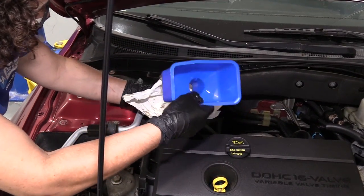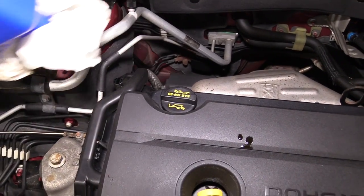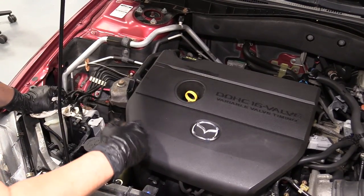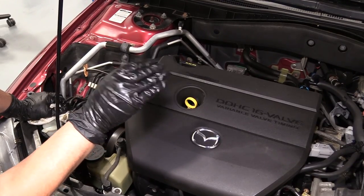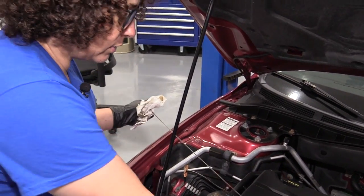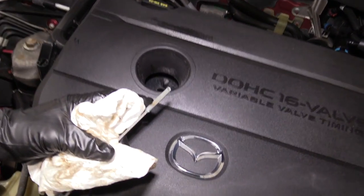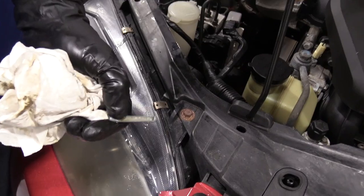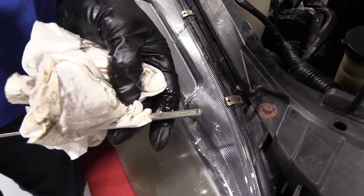Now I'm going to take my filling funnel out and reinstall my oil filter cap. It has a lock system on it — you can feel it snap right into place and it's done, bottomed out. So I started the car up and let it run for about a minute, then shut it off. If you have a car that has an oil gauge on it, you'll watch the gauge go up in pressure and then you can shut it off. Or you'll have a little oil light that looks like an oil jug — when that light comes on for a second and then goes out, you can shut your vehicle down and come check your oil level. You're going to pull the dipstick out — it's located right with the yellow handle. Clean the stick, put it back in, and pull it out. We want the oil to be at or just a smidge below that top line. Once you remove the dipstick, you can see that the oil goes right up to that fill line. If you find it a little underneath, that's fine — you just don't want it above it.